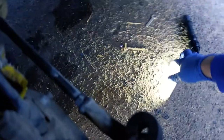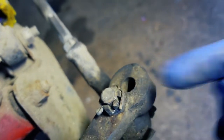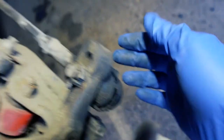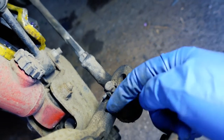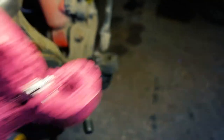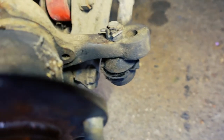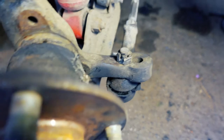So basically this knuckle was drilled right here and we put that right there. But as you can see, this is toast — we've got a replacement for that. The other one is cut and then this part is moved in and then welded again, and it's actually much shorter. Here's the other one for comparison — it is much shorter than that one by a pretty long shot, actually. So we should be getting some pretty serious angle out of it.